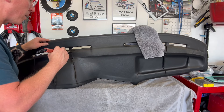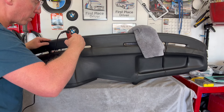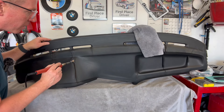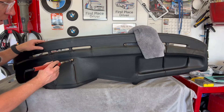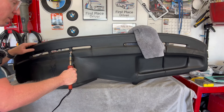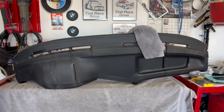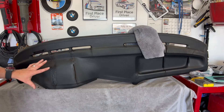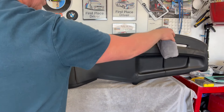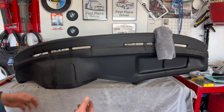Some spots, maybe we'll use some body filler - not Bondo, I've got a better product than Bondo from the body shop. And then you're going to spray paint the whole dash? Yeah, but before we spray paint it, we're going to put a texturizing spray on it. Because if I painted over this after we sanded it, it would be obvious. Now, if you're going to Flock the Dash, the texturizing piece doesn't matter. Would you even have to fill it if you're going to Flock? Yes, you would - because it's still going to move and stuff like that.